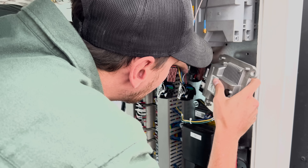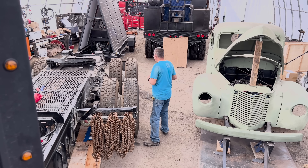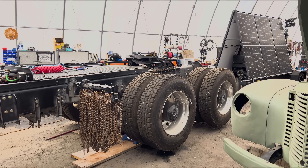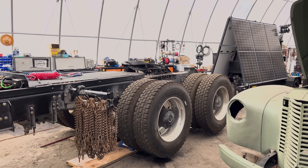Now we're back and Eric's installing it. Fingers crossed, that should fix our regen issue and we'll be back driving around this week. That is the new one going in. The nice thing about having it all in the back behind the cab — doing that entire swap of the computer probably took all of three minutes. Undo four screws, unclip it, clip the new one back in. Imagine if we had to go under a dash. This is such a simpler, easier way to service it. Look at that — they're both spinning the right way.